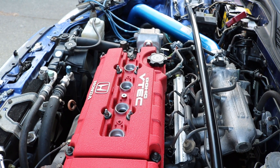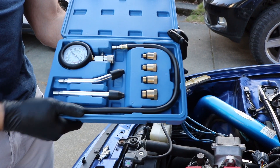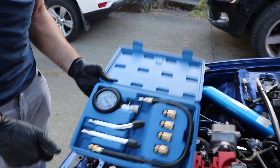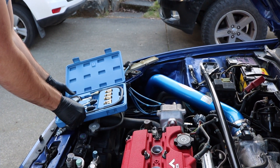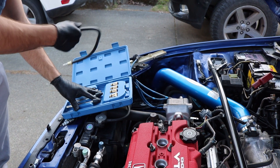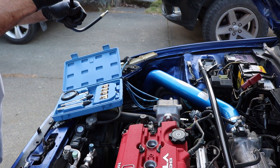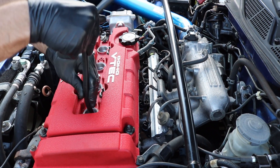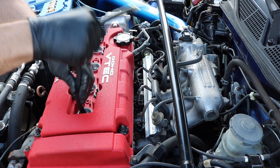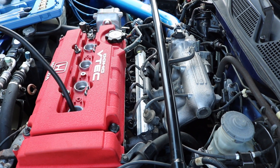What we're going to do is take your compression tester — this guy here. I'm going to put a link down in the comments where I picked this up off Amazon, just in case you guys want to order something like this. It's a very basic kit that allows different attachments for different vehicles, which is great. So we're going to grab our line, grab the side that we think it is — which is actually the one on the hose — and just thread it in nice and snug.